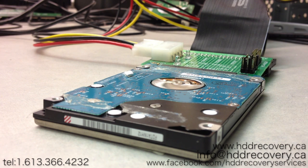Usually when you call a recovery company, they'll say a bearing issue requires transplanting the platters into a new chassis, which is the appropriate procedure, but it can get very expensive. On average, a platter transplant on a two-and-a-half-inch drive costs around sixteen to seventeen hundred dollars. If you can afford that, sure — but there's a trick I'm going to teach you today, an easier solution that may help a lot of you experiencing this problem with Toshiba hard drives.